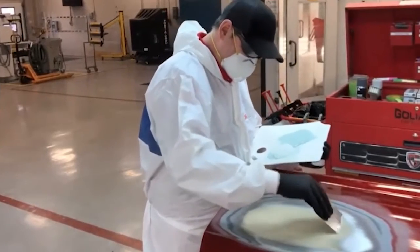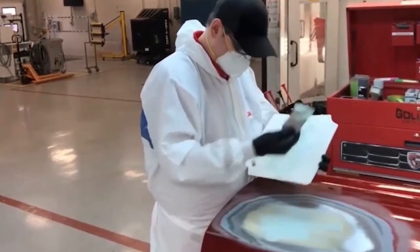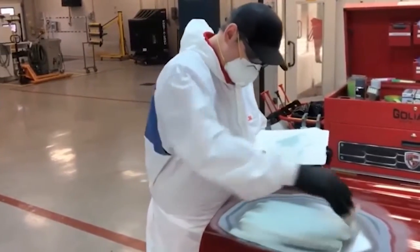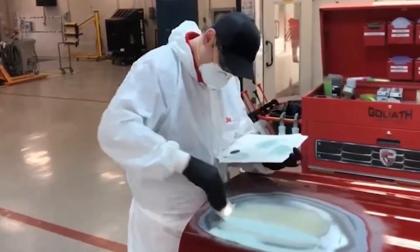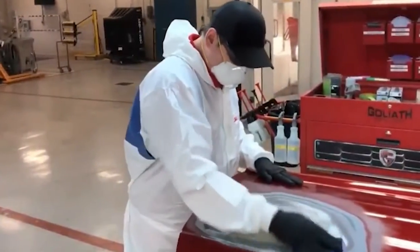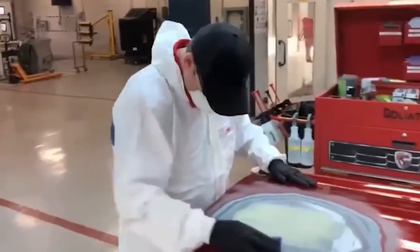A second method is to mix a small amount of glaze and, using a metal spreader at a high angle, apply a very thin coat over the repair area, then clean the spreader and scrape the remaining glaze from the panel again using a high angle. After the glaze is dry, take a piece of abrasive paper — preferably P180 grit or finer — and using a sanding block, lightly scuff off the remaining material.